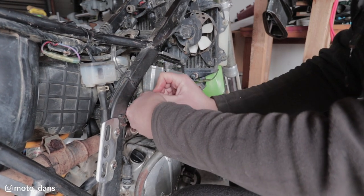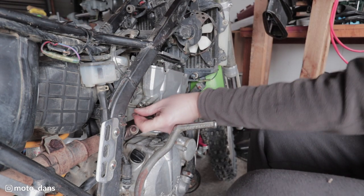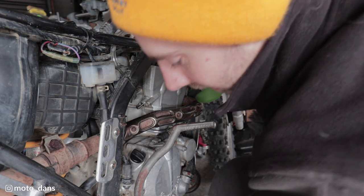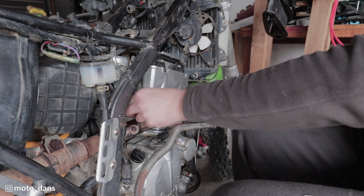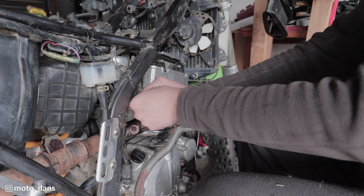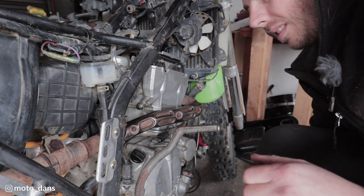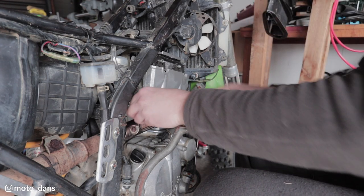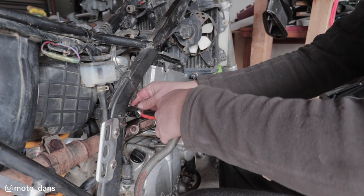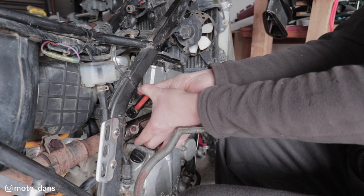Just a wee nip up on these ones with a quarter inch will be fine. Now we can put the spring back in. You'll hear that tensioner kick out. And then put our end cap on - you should hear it go out just a little bit more. It's a wee bit awkward with the exhaust there. That tensioner just clicked out another couple of times, so that's what you want.